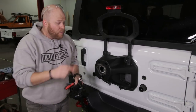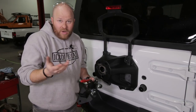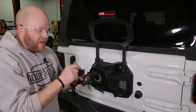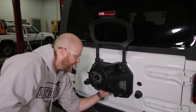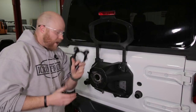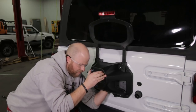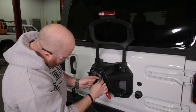If you buy our tire carrier that mounts on the bumper - the gate swinging one or the adventure carrier - you don't have to worry about that at all; you just take this thing off and throw it in the trash. Now that it's nice and smooth, we're going to put the stuff back together. You'll also have to cut this same little tube off from the spacer the camera was mounted to - this is plastic, no fire concerns. Pop that up where it was before, grab the original studs for the spare tire, slide those through, and use the T25 to put the original two bolts back in.